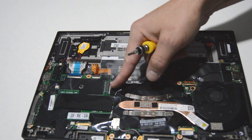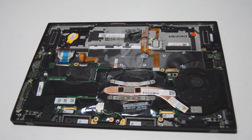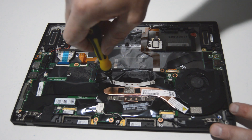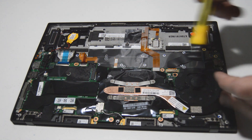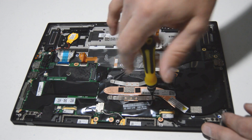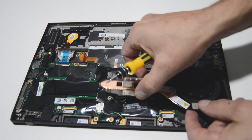Taking a look inside, they have used a lot of plastic cover on this model, so we're going to start from the top and work our way in. We'll go ahead and remove the fan and heat sink assembly. They've used smaller type screws for the heat sink, so I'm going to switch to a 1.5 Phillips. Each screw has a number stamped next to it — that's the tightening order once you go to reinstall the heat sink, but it doesn't matter which order you remove them.